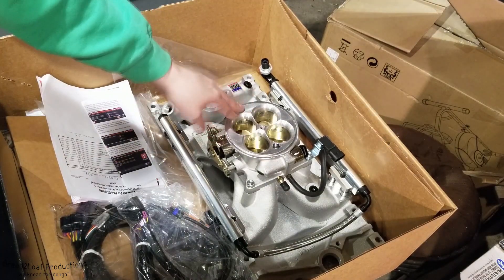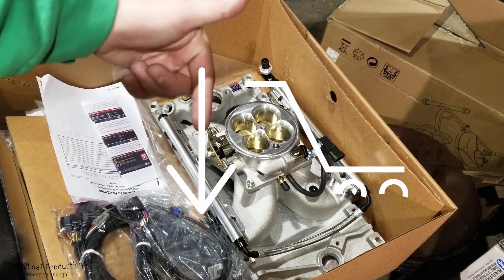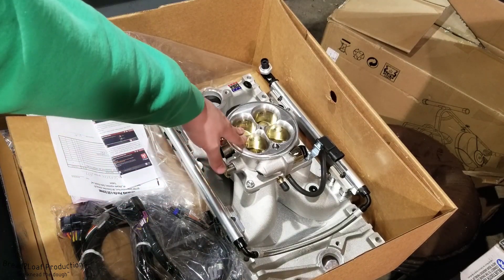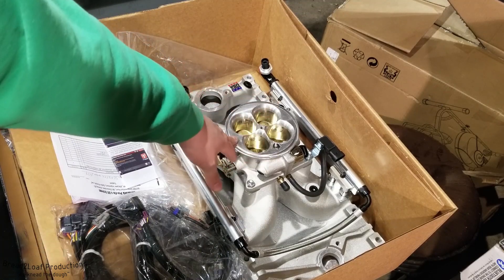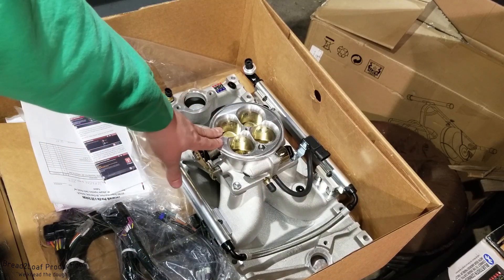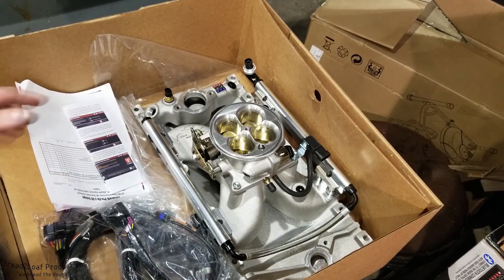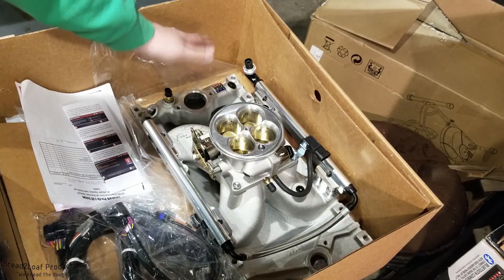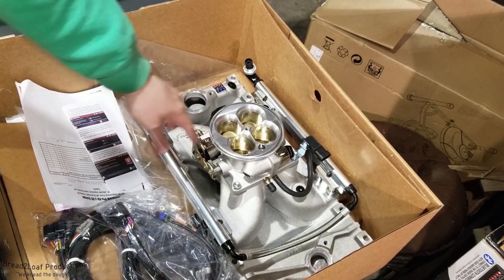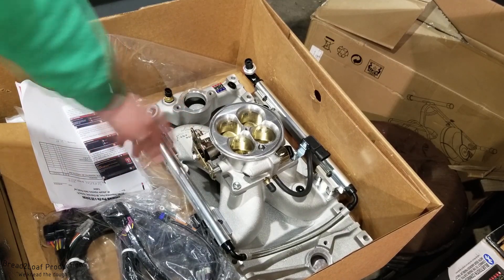Later on in the series you're going to see us install this, run it, and tune it. We'll put a link in the description for this kit. There's the traditional intake style for the ProFlow 4, and then they have an XT version — a long straight channel running parallel to the longer side of the intake manifold with a circular 90mm opening and a large butterfly valve, more reminiscent of a race style intake manifold. We decided to go with the traditional since it fits the engine better for this relatively old small block.